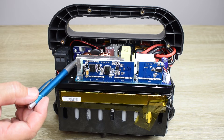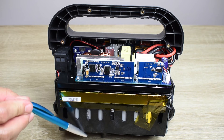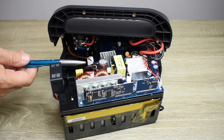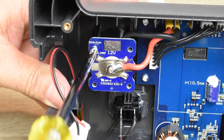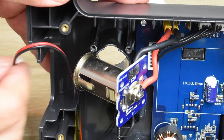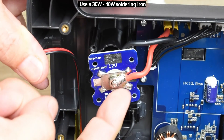To make it much easier to tie into the accessory socket, I'm going to remove the whole battery bank with the inverter board. There are four screws — one on this side, one over there, and two underneath. As you can see, it came right out of there. With the connector undone and this removed, I have plenty of room to work in that area and remove all four screws from the accessory socket so the whole piece can slide right out. This side is the negative I'm going to be tying into, and the positive is going to be connected right over here on that spot.